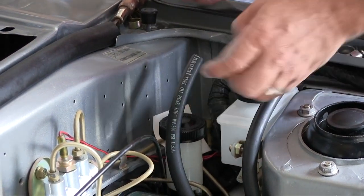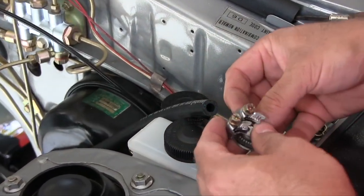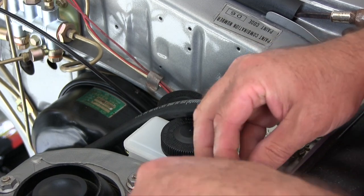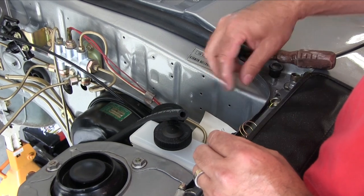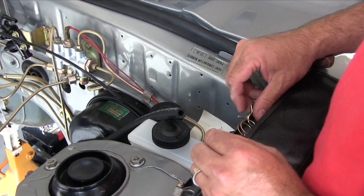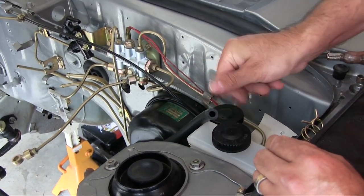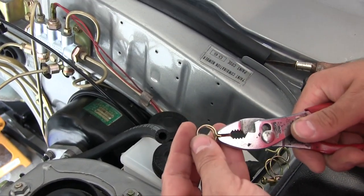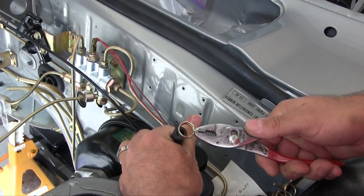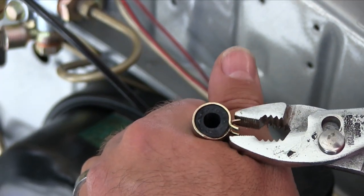Is that going to be too small? So these are typical aftermarket hose clamps with the band. They came off the master cylinder coming from Phil's Rotary. I was hoping to replace them with original equipment Mazda clamps, and there's different types, none of which are quite right. Original hose clamps on a brake master cylinder was a wire, and it was wrapped around and then twisted up. So looking at the different ones here, there's this type here. It came on some of the smaller hoses, and it would go on. It's really tight. I'm not sure it's prudent to use that.